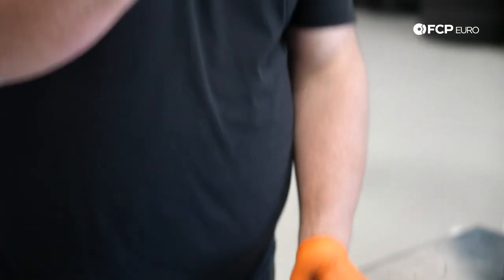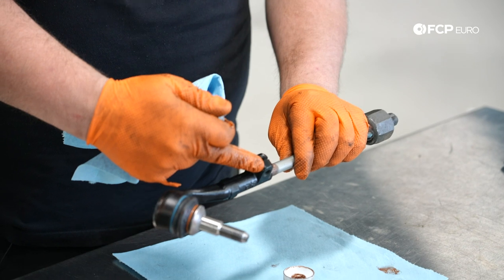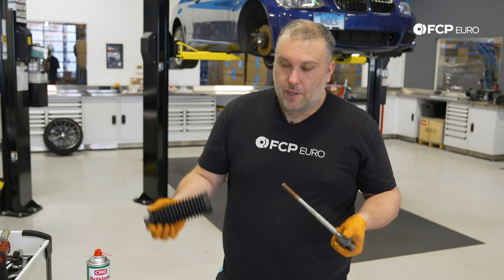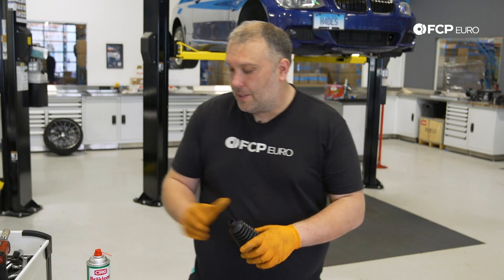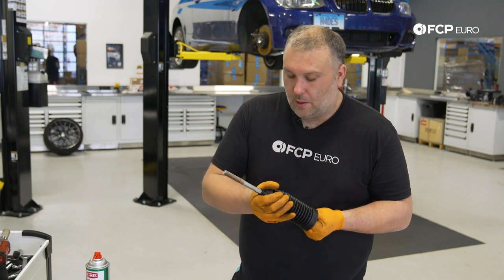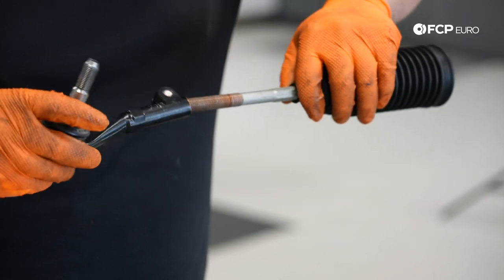I'm also going to do the same thing for the locking screw. Normally, a lot of tie rod ends have jam nuts, but BMW switched over to a locking screw that clamps the adjustment down. A little bit of anti-seize on that will help prevent it from getting stripped out in the future. Then go ahead and slide the bellow on — you need to do this beforehand or you'll be sad. Using a little bit of brake clean as a temporary lube works well for sliding the boot on. Just make sure that when you put the boot on, you also put the clamp on.